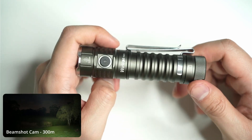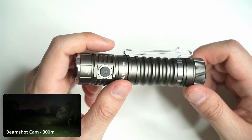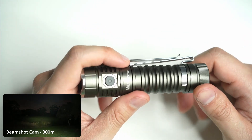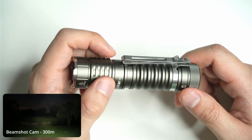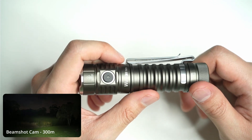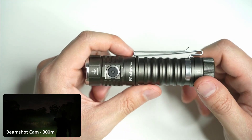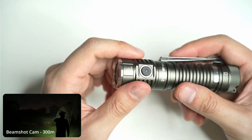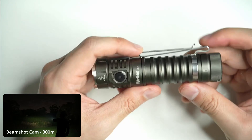A consideration is that Anduril 2 is a personal preference — not everyone likes it as it's quite a tricky UI. It's also important, if you want the light to maintain and sustain its lumens, to set the step-down temperature to a higher setting, at least 50 degrees Celsius. Most lights aren't set properly and ramp down too quickly. I've got a video on my channel showing how to do that. If Anduril 2 is too difficult, you can set it to simple UI mode — it ships that way — though you lose access to the advanced functionalities.